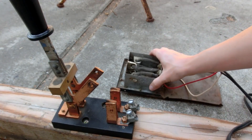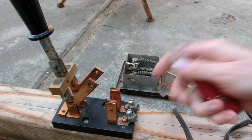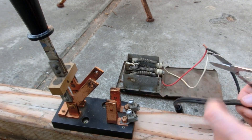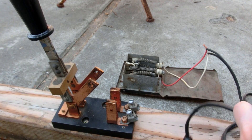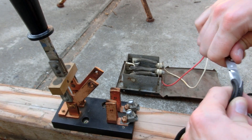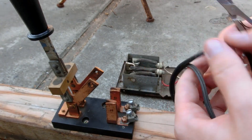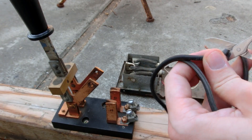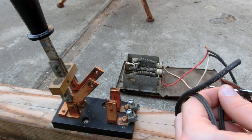So the heating element is wired to always be on while this is plugged in. I want to add a switch, so I'll add this in there. I'm just going to cut this wire to get access to one of them, to insert this into the circuit and give me a chance to break the circuit, which is pretty good in my opinion.